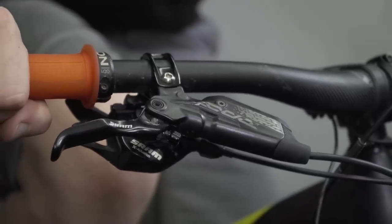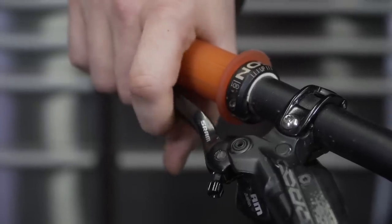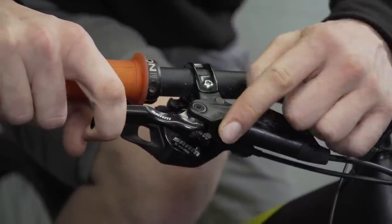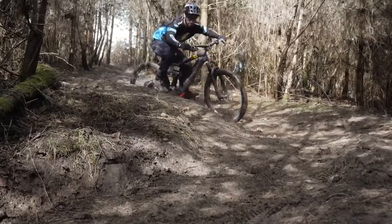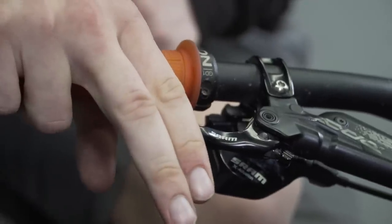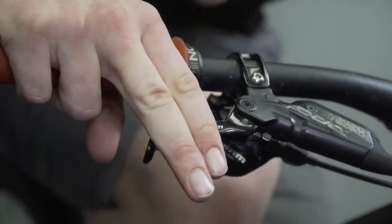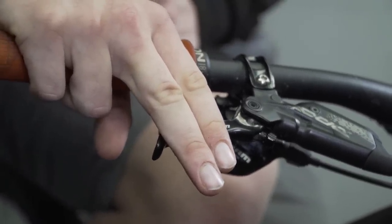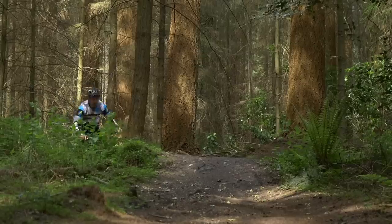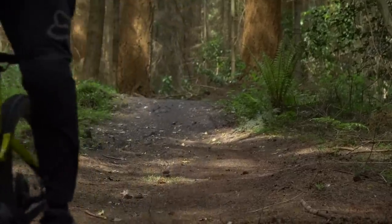From the other end of the bike are, of course, the levers. How you have your lever set up is a really personal thing — I normally have my levers pulling all the way so they touch the bar, though most people find that horrible. They normally have a reach adjust that affects how far or close the lever sits. When people begin riding, you'll often see them do two-finger braking — but that's not how these levers are intended to be used. Whether you have one or two fingers at the brake, it won't affect the power at the caliper, but it will affect your grip on the handlebar. This is a very weak grip. Having your finger in the hook of the lever blade gets the most leverage and is the most powerful way to use them.